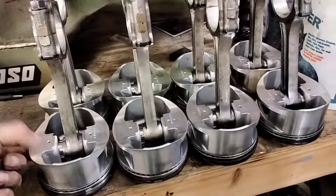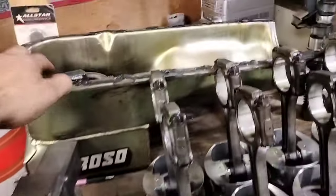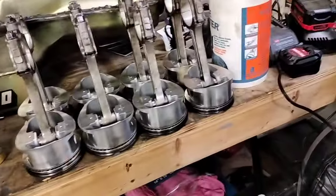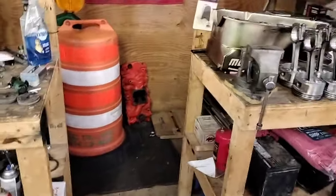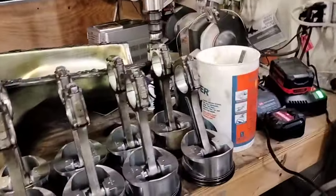These pistons are 425 series pistons cut for a spiral lock. We're going to go with a full floating pin with spiral locks. The oil pin looks good. These pistons are nice — it's not a modern ring pack, but we're not going to worry about that. There's minimal scuffing on both sides. I have to clean one piston because it got a little rust — hopefully we can polish that up and polish the ring lands. The rings are still moving, so it shouldn't be a problem.